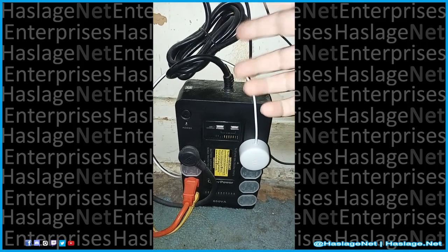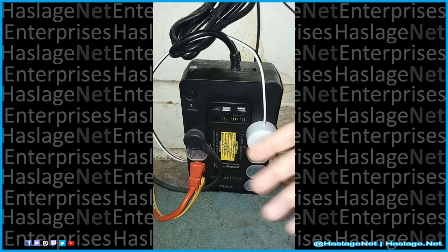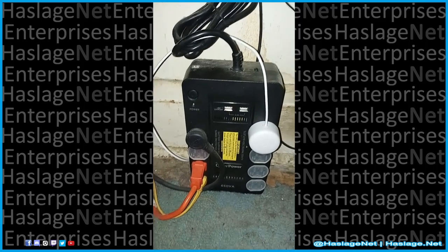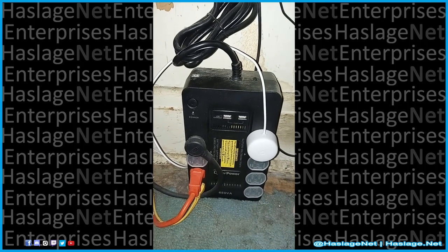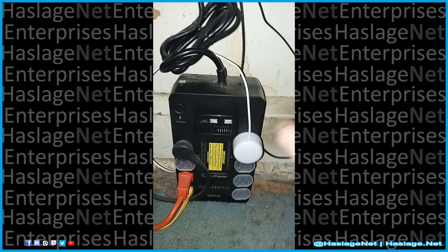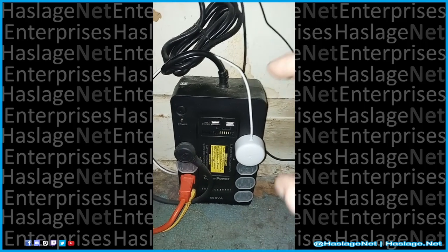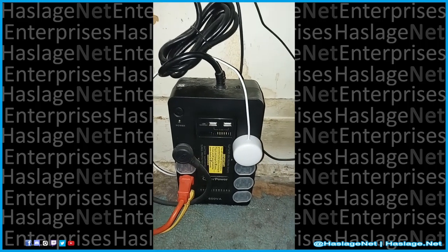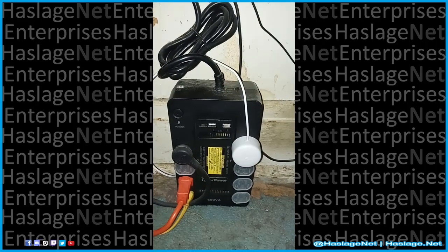As it's charging it passes through power, and once fully charged it continues to pass through until it needs to pull from the battery. When it switches to battery it beeps every 30 to 45 seconds. When it's near drainage it fast-beeps, which is annoying. During our recent outage it actually started as a brownout — still getting some power — so I turned off everything else to conserve the battery. Even under brownout conditions it was beeping like it was running out of juice, despite power still trickling in. What that tells me is in a brownout it will indicate when you're drawing more than the battery has, but once power went completely out it went back to normal 30–45 second beeping.